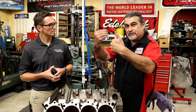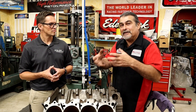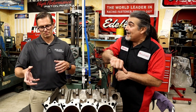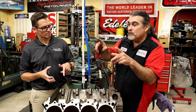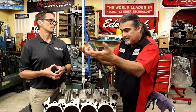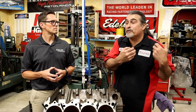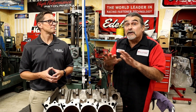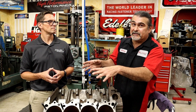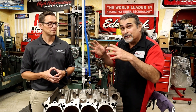As you slow down and get to a light, the computer closes the solenoids and the springs — because there's no oil pressure — push the cam back into its natural state, reversing the cam. Old school, when a motor was worn out, we'd up the viscosity — go from 20W to 30W. But with variable cam timing, which is basically everything nowadays, oil viscosity is crucial to the tune of that motor.